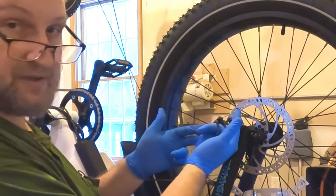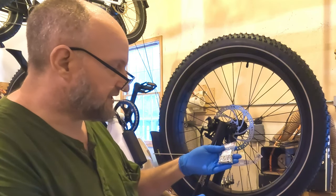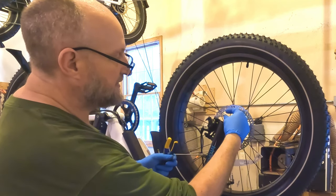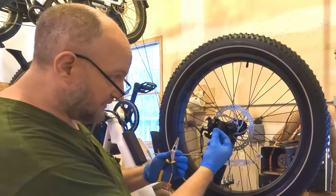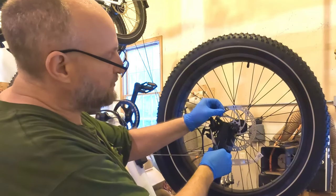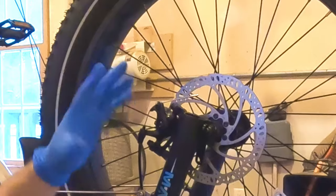Before the cable gets frayed, let's put a new cap on it. I got a bunch of these little cable caps off Amazon — they're pretty cheap, a pack of a hundred for just a few bucks. To put these on, slide them over the end of the cable — right now it just slides in and out. Use the wire cutter portion of your vice grips just to crimp it; you're not trying to cut through, just crimp it onto the cable. Do that in a couple different orientations and a couple different spots so the cap won't come off and the cable won't fray — that gives you a nice finished end. The caliper is still loose on the bracket; I'm going to leave it that way until I get the bike down on the ground and do the finish adjustments there.